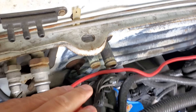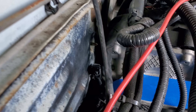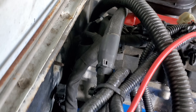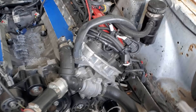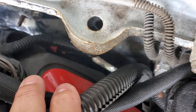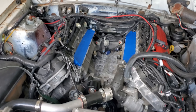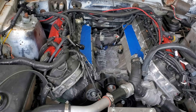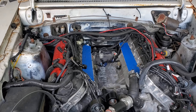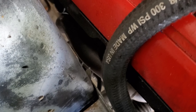A big reason false knock happens on swap Mustangs is there isn't a lot of clearance. It is super tight everywhere, especially in the back, because these motors are wide and have huge cylinder heads due to the dual overhead cam design. On top of that, swap vehicle builders tend to be cheap — they get the F-150 motor and then go with cheap headers. You can see right here that's actually really good clearance for an aftermarket header — this is an Ultimate Header.